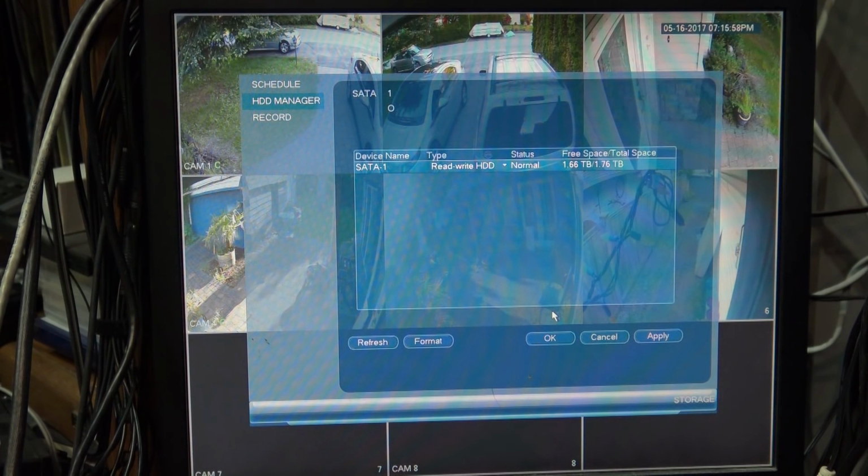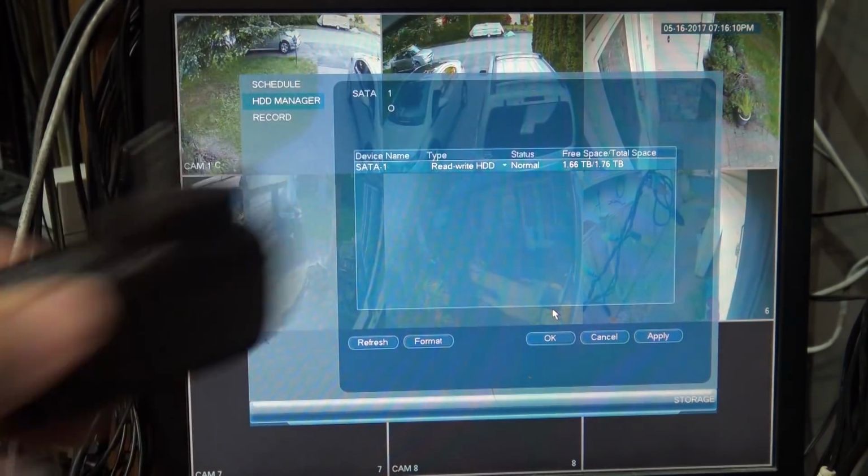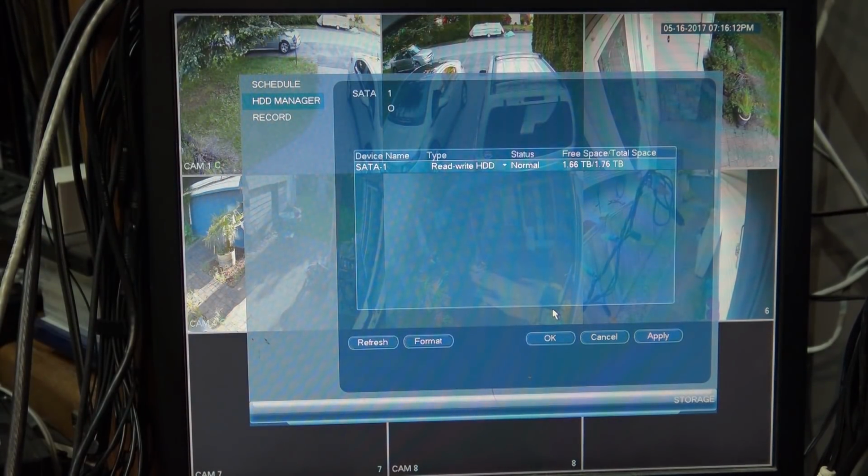The reason why that is because yesterday when this thing first started acting up, it was responding really slowly. So I did a format of the drive thinking maybe the drive was corrupt, but it started beeping again. So obviously the problem was the power supply. The voltage must have been dropping off a bit on it, and it was slowly dying.